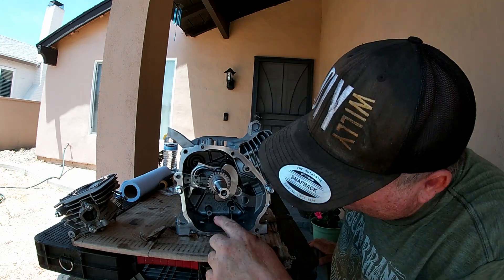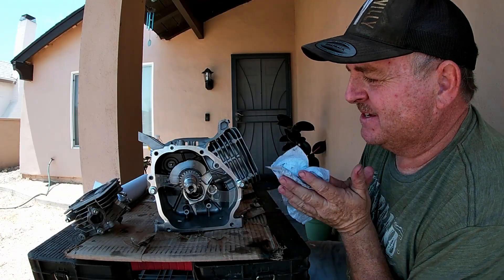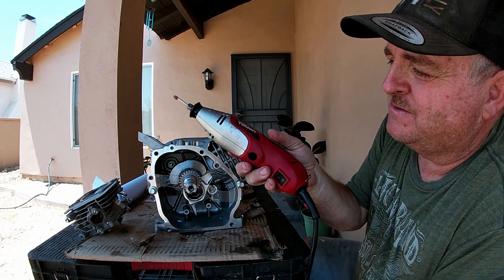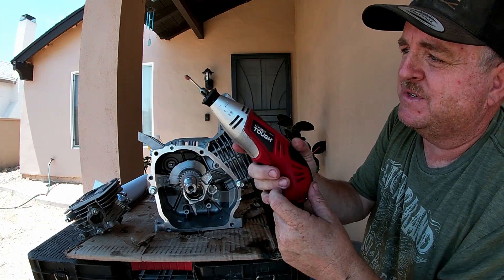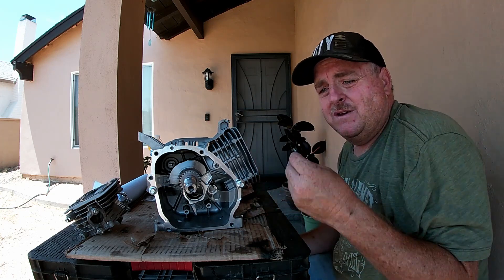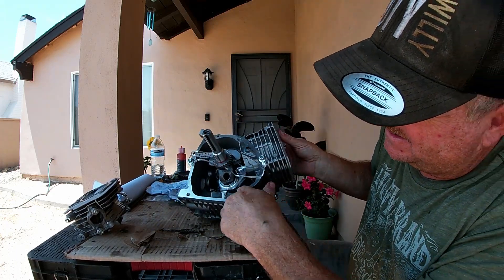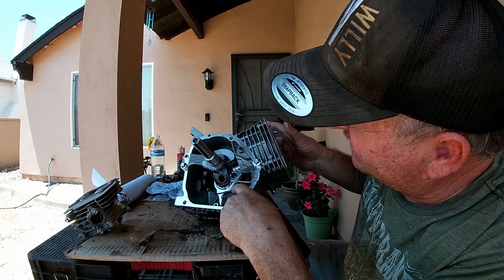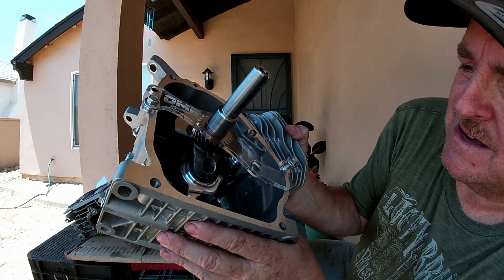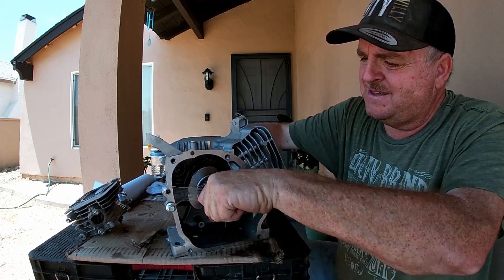I'm going to mark exactly where the oil dipper is right there and then we'll grind some of the aluminum away. I took my rotary tool - it's a Hyper Tough, one of those - but it works pretty good, it's got variable speed. I started off with a burr and ended up with a stone to kind of smooth things out. So I got it clearanced on the back where the oil slinger goes, I got it clearanced up on the top and on the edge of the cylinder, and on the bottom. It will do complete revolutions now without making contact to anything - it works really good.